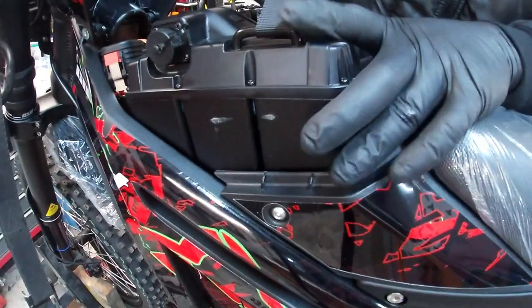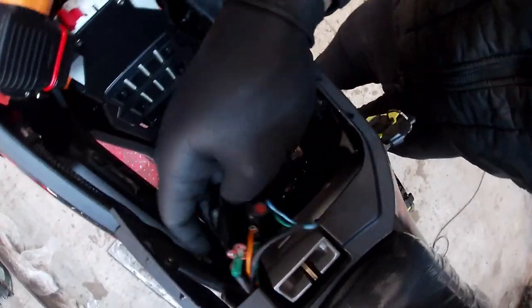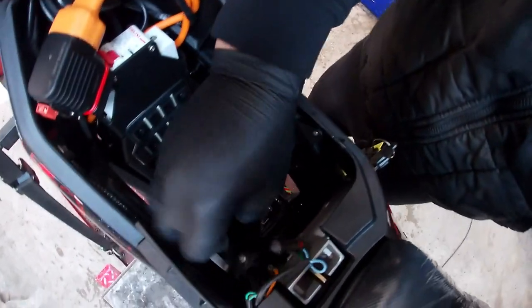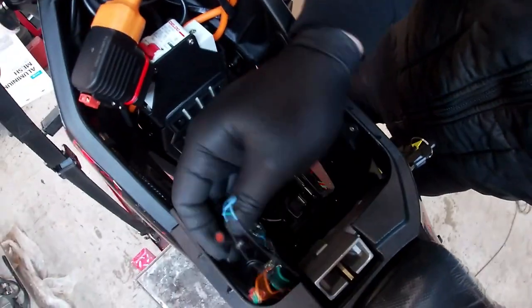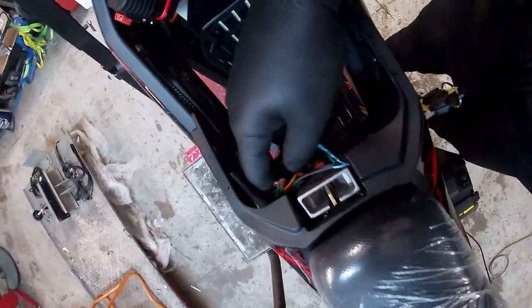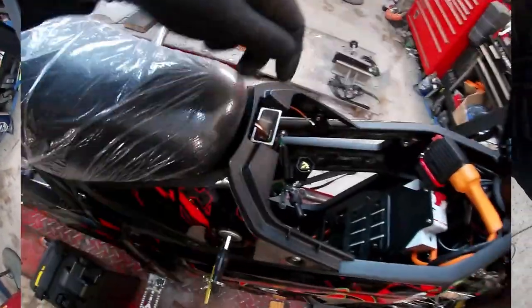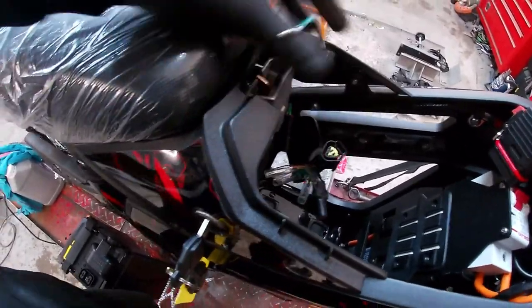Battery comes out, and then inside here, tucked away, you've got a load of wiring covered in a little plastic sheathing. What you do is unplug the rear light - which, as you can see, doing it with one hand is a little bit difficult. So inside here there's a plug - unplug it - takes out the tail lights. It's a bigger one of the two because it's the road legal one, so you've got your indicators and your light unit. On the standard one you've got a little two-pin one.